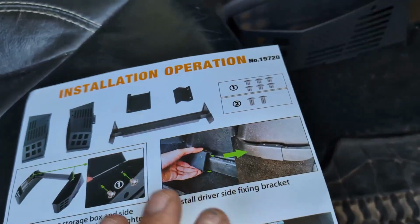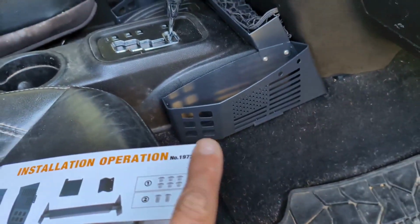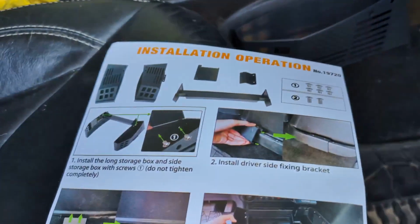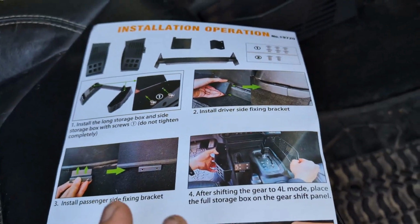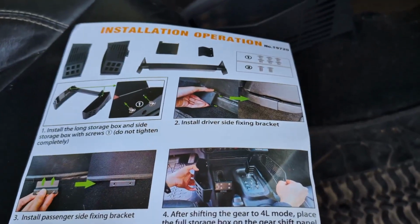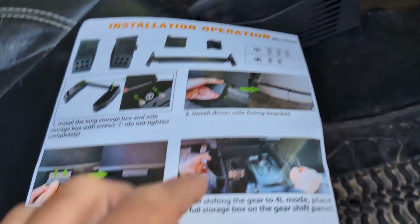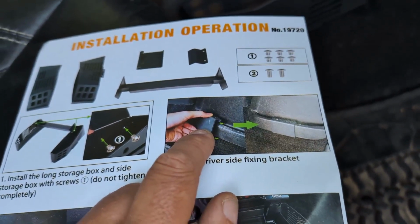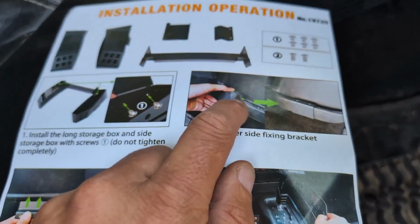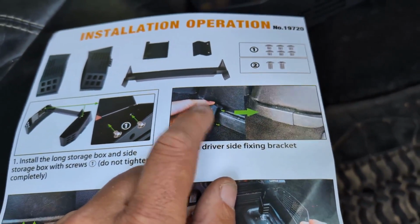And so because these tolerances of where this is are going to be slightly different, and because manufacturing is always off a little bit, you're gonna find some little bit of complication installing this. I just did, and I'm pretty sufficient at doing this type of work, but just to note that you want to go slow, don't over tighten. This is aluminum, so this piece here is actually pre-tapped, so it has threads on the inside. So if you over tighten and compress against that, you can strip the threads out of this, and you might have to go grab a little nut to go on the end.